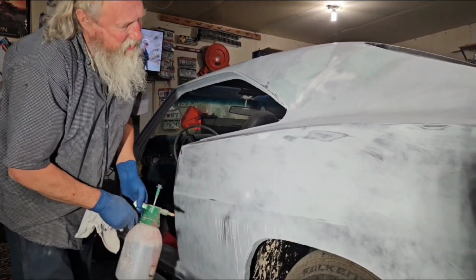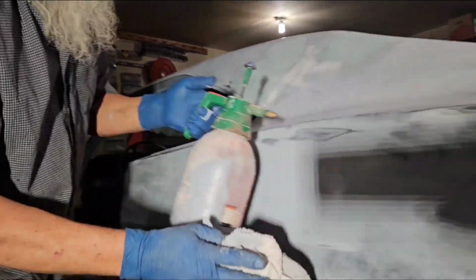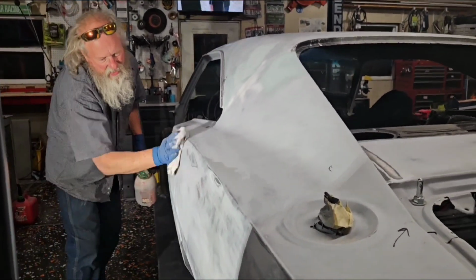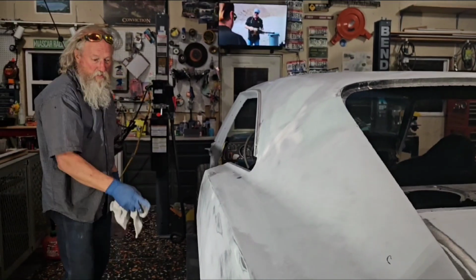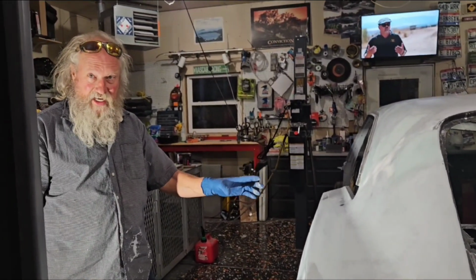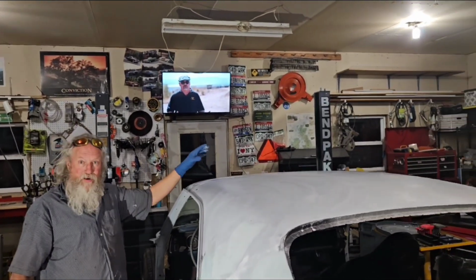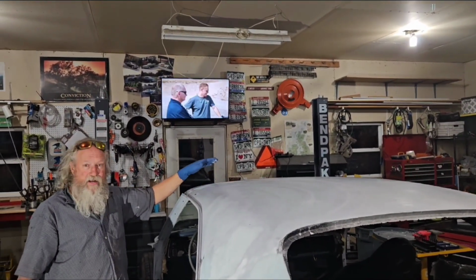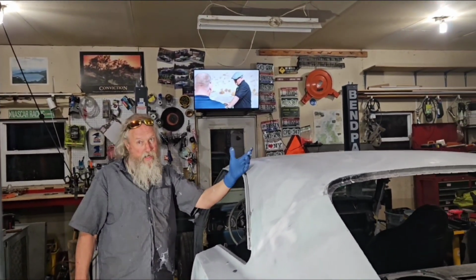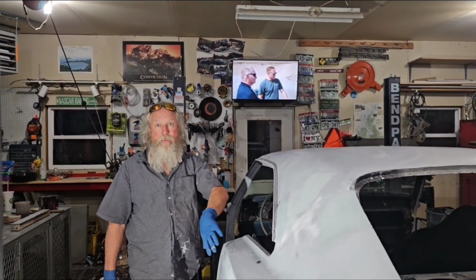Ah, there's some body work. Yeah, see somebody's body work. Yeah, that was me. It's pretty close though, because it's not leaving a lot there. It's hard, man. It's because, like you said, it flares out. But even with my own body work, when I get to this stage, this shows me stuff that I don't see. Even when you primer that, you're liable to see a few waves. Even though it feels good now, when you go to sand it, this is more precise. You want near perfect, and there are waves and stuff that this will pick up.